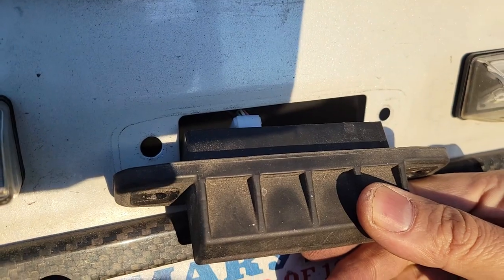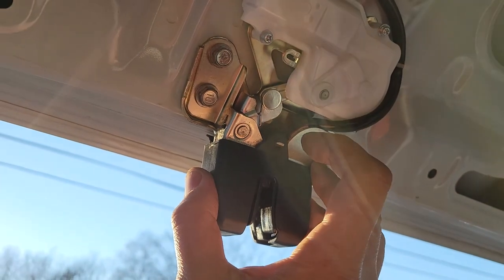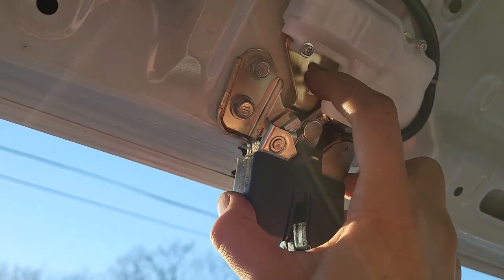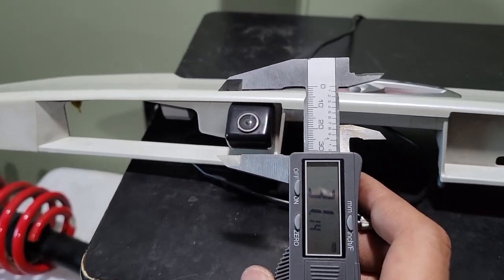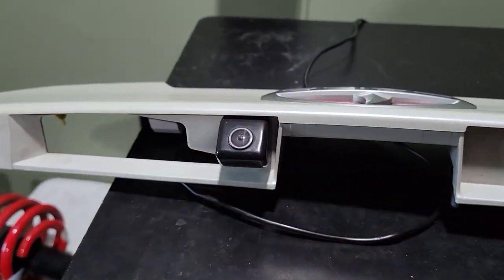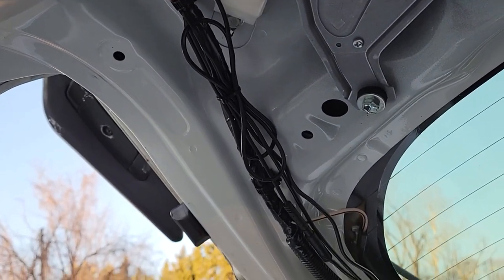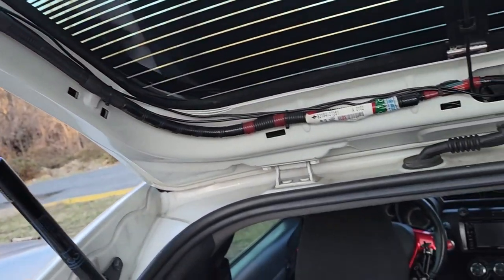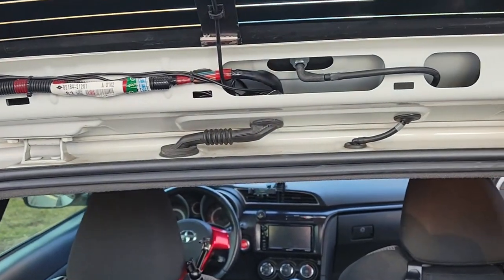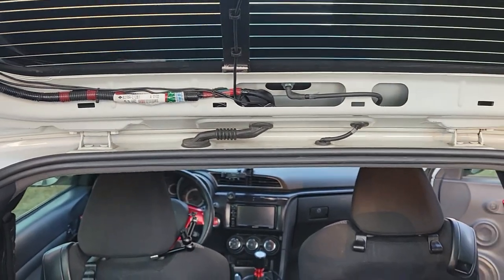Before I forget, a quick reminder to plug this back in if you need to close the hatch — otherwise you'll need to crawl in from the back seat to access the manual release lever. This mounting spot is about 31 millimeters deep, so you'll want to stick with a 1 inch or 25.4 millimeter camera. I have my old camera reinstalled and the excess cable zip tied. I've secured the rest of the extension cable to the factory wires to prevent it from getting damaged or rattling around. WD-40 will be your friend when pushing the cable through the rubber connector here. I'll have a link to the hatch trim guide below.